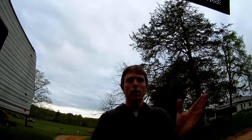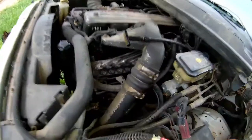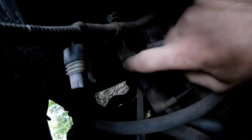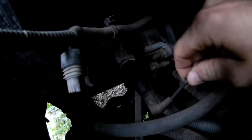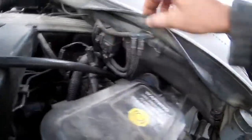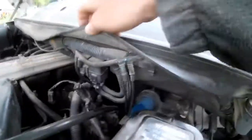The first thing we have is the vacuum pump, located down below there. You can see where the vacuum pump is located. We've got this little adapter going from the half inch to the little itty bitty vacuum line, and that goes up to the manifold and feeds the manifold up here. This is basically a line that runs across the entire length of the firewall that feeds all the various things.